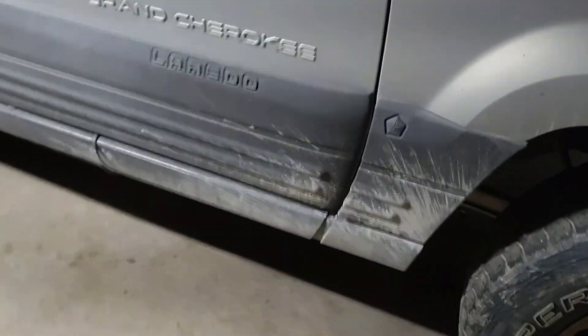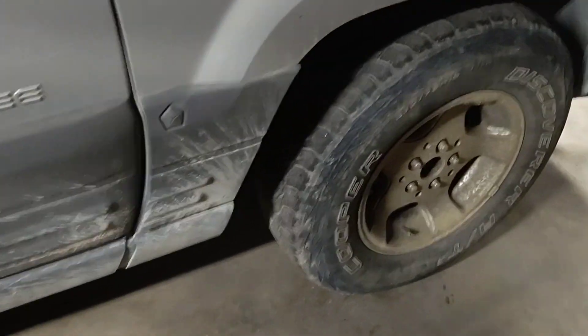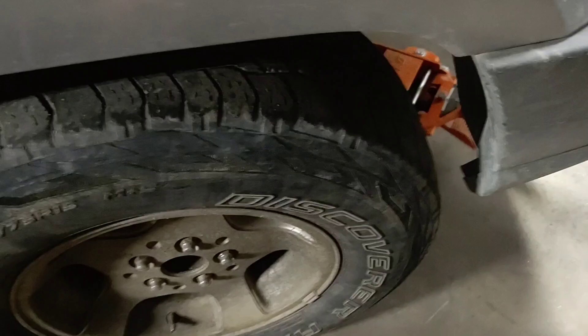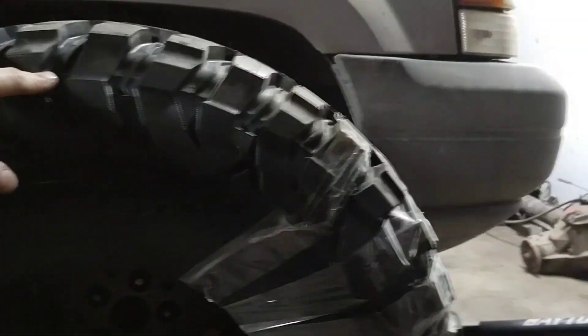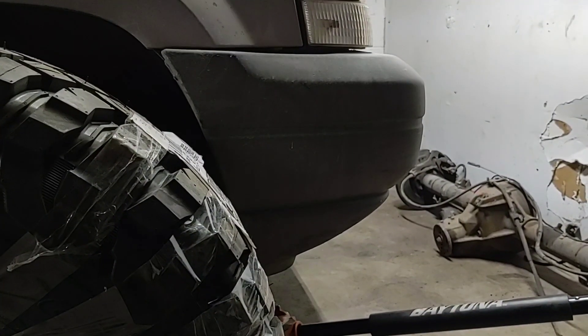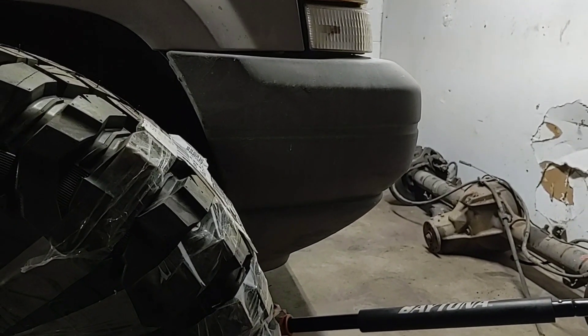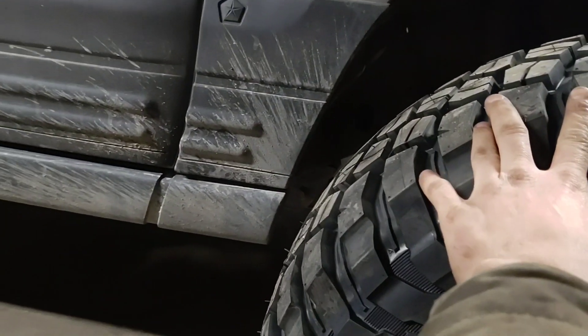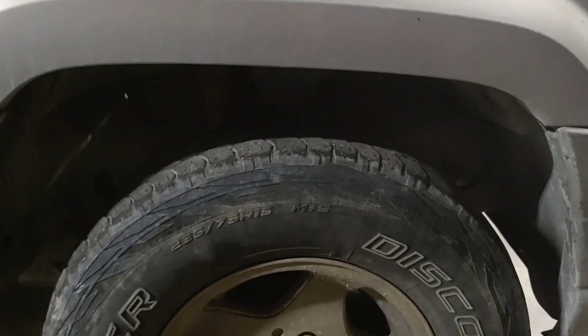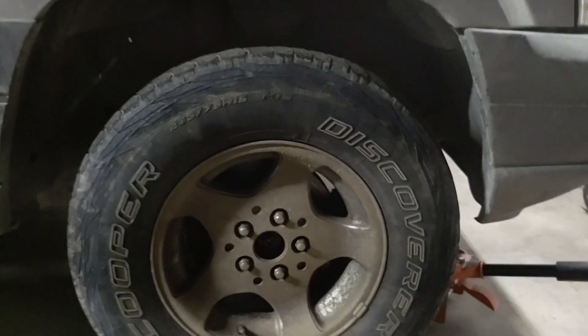Right now I've got this thing picked up so the tire is kind of lined up with the wheel where it's going to sit. We definitely got — I'm going to take the bumpers off for now, but you could trim it. If you hit any bumps that's going to kill it. Other than that we're kind of fitting. That's at factory ride height because the jack's on the axle. I've got three-inch pucks coming and I'm just going to make shock extensions for now.